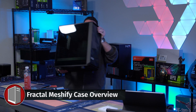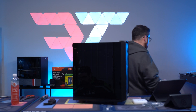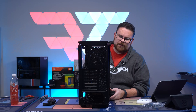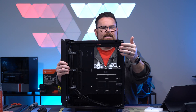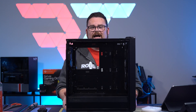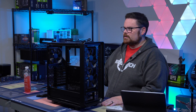So now we get a look at the case — this is a brand new case from Fractal, the Fractal Meshify 2 Compact. To open it you start with the top, take the top off, then remove their Fractal-style dust filter. There's support for up to a 280mm radiator at the top and up to a 360mm radiator on the side. This thing has airflow slots everywhere. Fractal did add Velcro in the back for cable management, which is neat, but it is very shallow in the back compared to cases like Corsair or Phanteks. It's smaller — it won't take up near the footprint, but where you pay for the size you lose some of the functionality that makes it a little bit easier to build in.